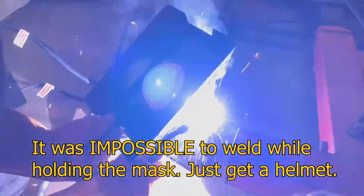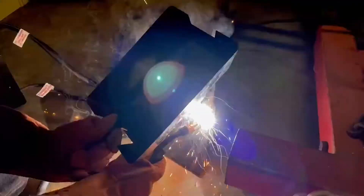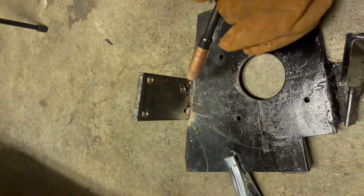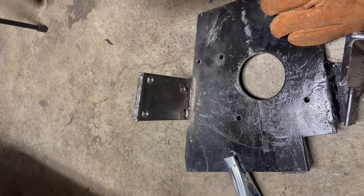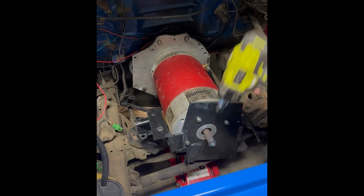It's kind of like a really heavy, messy puzzle, but eventually I had it all mocked up and welded all the pieces together and threw some paint on it. This is a good time for a brief aside on the Harbor Freight flux core welder — this thing was a hundred dollars and came with the saddest little welding helmet, but it worked. It took quite a few tries; it comes down to finding the right settings and keeping your hands as steady as possible. I'd weld it, think 'that looks terrible,' grind it down, and weld it again, but after a few tries I got it good enough to pass the sledgehammer test.